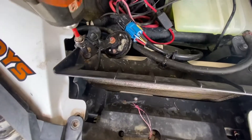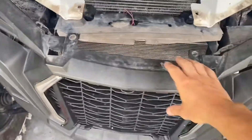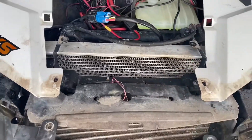Next we're going to pull the shroud off — same thing, T40 on top. There ended up being two more T40 Torx bolts over here that are kind of a pain to get to. Just because of the angle it's on it's a bit tricky, but now we have the front clip pulled forward, just kind of hanging there. I need to get it out of the way so I can get in there and remove the radiator support and start getting ready to slide these out the top.